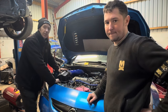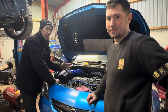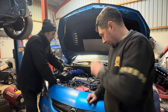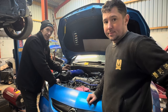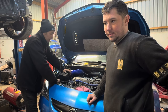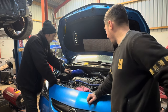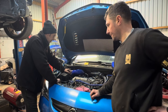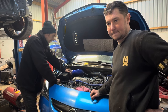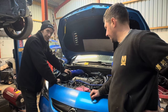It was a bit concerning that we couldn't put the actual locking tool in. They were still very fractionally out for putting the locking tool into place, even though the coloured links matched all the right locations. So potentially the camshafts are very, very fractionally out, but it will just be a fraction, because we are getting 160 across the board now with it. So I'm going to go have a look at another set, and hopefully we'll source a set and a new chain kit, get the timing back straight, and it should allow it to then physically run for us.